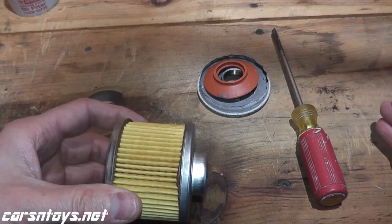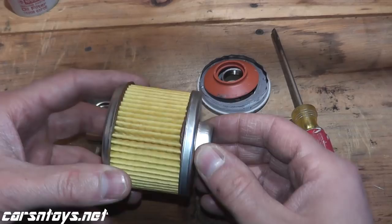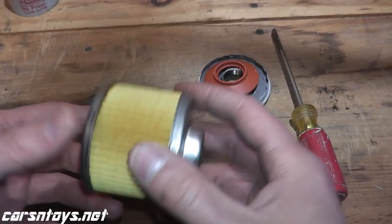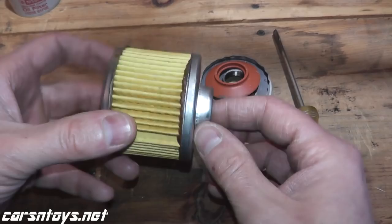As a rule of thumb, I checked a number of them and it seems like this is good up to 6 months or 7,500 miles. If you're towing or in stop-and-go traffic, they recommend every 3 months or 3,700 miles. This filter is used for the 350Z, 370Z, Maxima, Murano, and Rogue, among a number of models. Just check your owner's manual to see when they recommend replacing it.